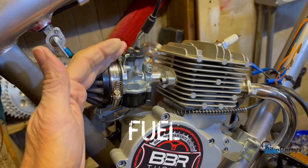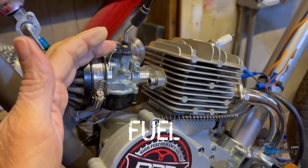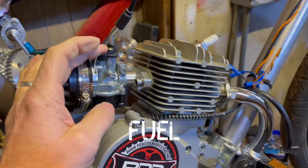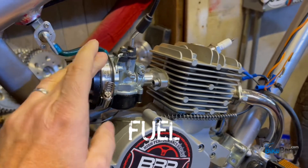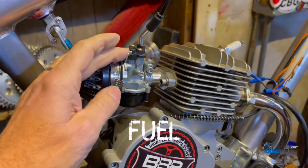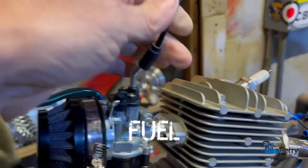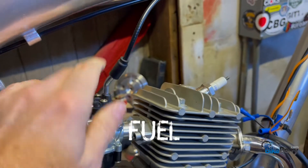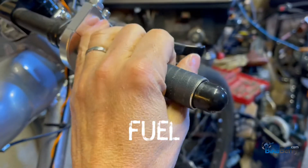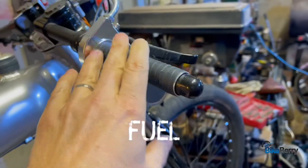Over-choking can cause a flooded engine. If you smell gas, just wait for it to drain out and evaporate back to a normal level, then try again. That's also another reason I like to have another carburetor on hand — even if I flood it out, I can pop it off, put the new one on, and be on my way. When I say swapping a carburetor, I'm setting them up with a cable and a throttle grip as part of the assembly on the shelf. That way I can take the whole assembly off, pop a new one on, and I'm rolling.